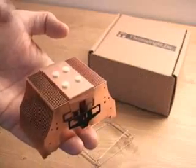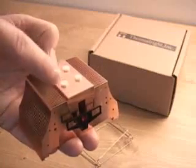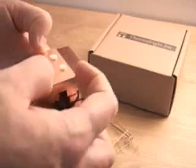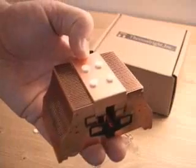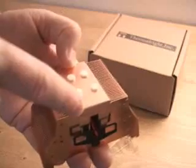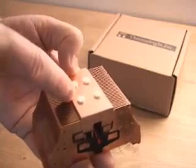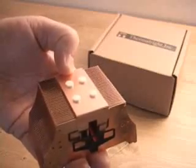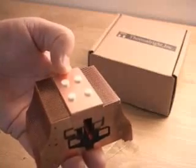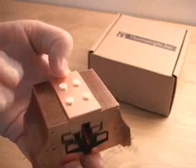You want to use these pads on the heatsink itself — just put them on like shown here. The reason is that the base is so narrow on this heatsink it's going to miss the rubber ones on your CPU. So make sure you install these on the CPU and/or on the heatsink itself, just to make sure you're not chipping the CPU when installing.